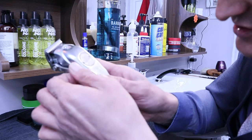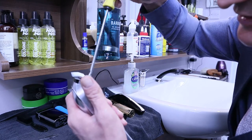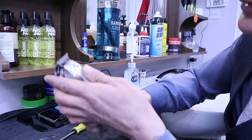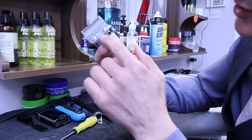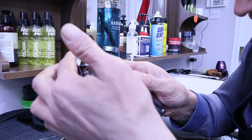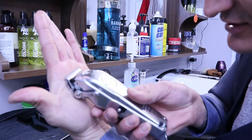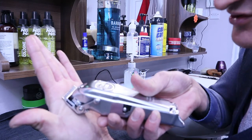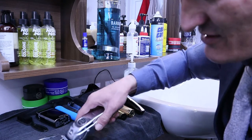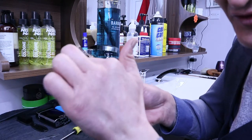Once you're happy with the level of your blades, slowly and gently give the screws a little more turn, then double check your blades again. If you're happy with the blade levels, go back and get your screws nice and tight. You can also put your hand behind and look at the level that way — when light hits the blades it can be hard to see, so having something dark behind gives you better vision to see your blades clearly.